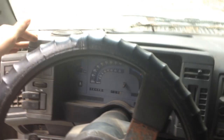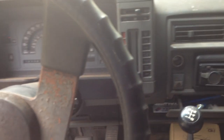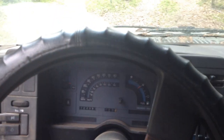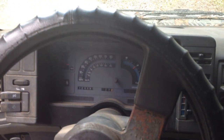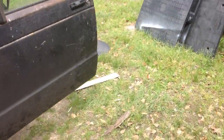Two bolts here, two bolts here. Unplug this side completely and you can swing the whole plastic frame around and keep the AC controls attached. Once you get below there, there are four bolts holding the cover, and once you pull that off there are four more bolts holding the dash itself.